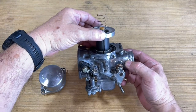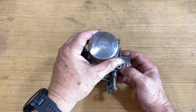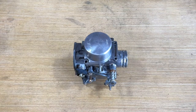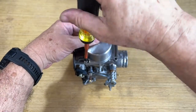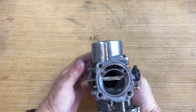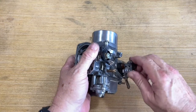Get the needle down into it — needle seat, needle jet. We want to put the cap this way. Spring goes into there. There we go. Now screw through. Let's see if that guy moves — oh yeah, quite nicely. Accelerator pump works well externally.